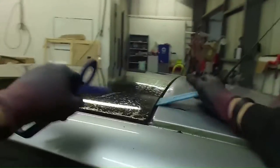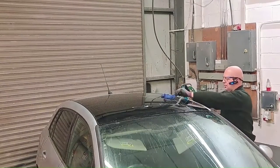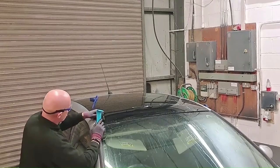That's as much as I can get from the outside, so I'm going to use my pry tool and see how much of the glass I've got free. If there's any bits of glue left, usually when you put these pry bars under it, it just peels the glue away. You can see that's the whole rear end and sides away. I think the front's got a bit of glue left on it — and yes, it's going to start breaking. So this is going to be a bit of a problem.